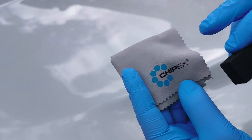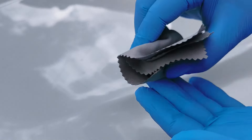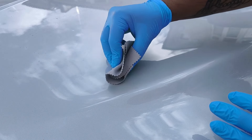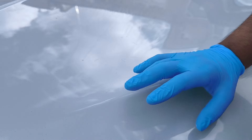Give it a few minutes to dry. With the blending block placed right underneath the cloth, you get a nice flat surface. Put the blending solution on top of the cloth and then lightly rub on the paint — don't push forcefully, very lightly — and just keep doing that again and again until you're happy with the result. Apply a couple of dabs of blending solution and lightly rub, taking off any excess paint. Then add more paint again, building it up until it's nice and flush and level. Then we'll add the second paint coat — the metallic pearlescent type — and do this a couple of times before the final coat.